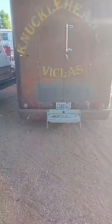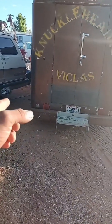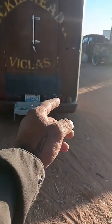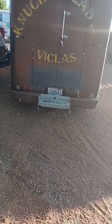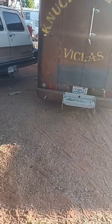But yeah, definitely now I'm the same distance from the lights to the bumper, because before this one was a little bit higher, so I was able to pull the frame down the other day. So now we have that leveled. It's centered for sure. And I think the tapering from the bottom is where it's gonna get us.